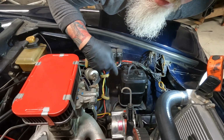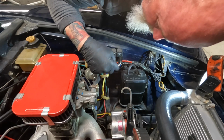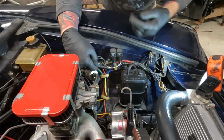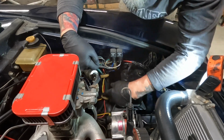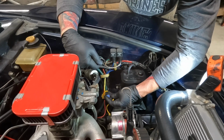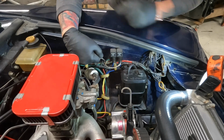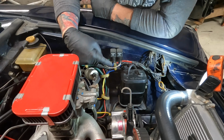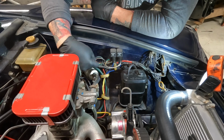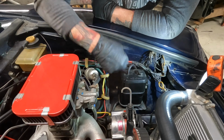So this is switch power on. Now then, power for the relays is the blue wires here. From blue, it goes through a fuse, and then I have it hooked to the alternator directly. It could go to the alternator or it could go to the battery on the solenoid. So that's where you get your power to feed the relay. This is the switch to turn the relay on, coming from the factory harness, from the dash, from the switch itself, and then going out to the headlights.